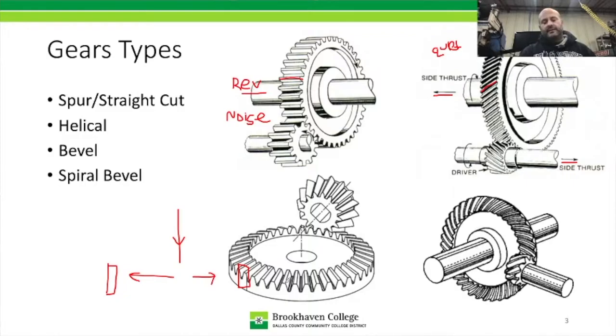The other thing is that the bevel gears are used within the differential inside a transaxle and in the differential of a rear or front axle. So these allow for a direction change, so the power can go down a drive shaft into the driver's side tire or the passenger side tire. The spiral bevel is just a little bit more efficient design, where the bevel gear can be noisy and have a lot of lash built into it, meaning there's a lot of space in between the gears. The spiral bevel gear is normally quieter, and can produce or transmit more torque because, again, just like it is over here with the helical gear, you can actually run a longer gear tooth.